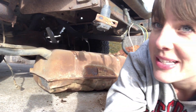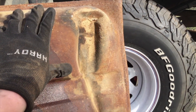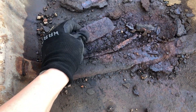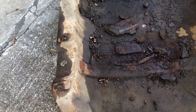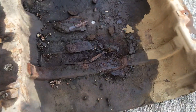That came out so easily — like, alarmingly easily. I'm glad I was being careful to brace the skid plate taking it off. I thought it was held on by straps; I don't know if I got that wrong or if mine is just missing them or they're broken. This was definitely banged in — I'm wondering if that's what caused the leak. Like, this is just gas dirt holding in a leak. I wonder if the tank is just shaped that way and not bent, because the skid plate's not bent. Unless it's a new skid plate and they messed up the bottom, decided not to do the fuel tank, and that's why there's a leak — and just slapped a new skid plate on. Which wouldn't be that big of a surprise.